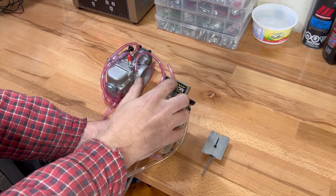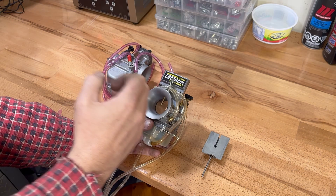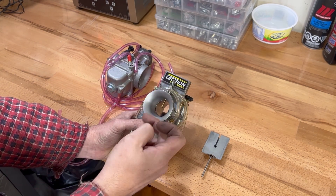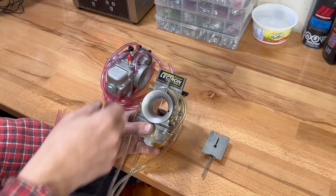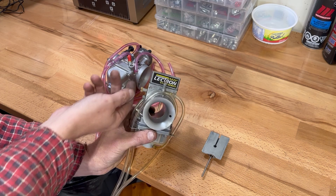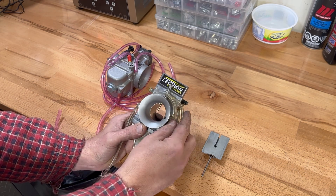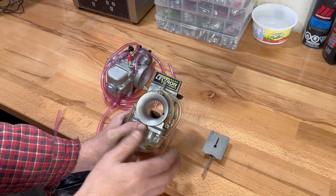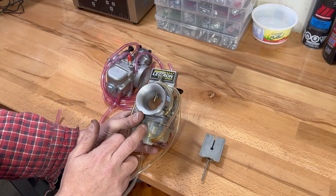When it comes to the power jet, it's actually opposite to what you'd think. If your bike's not revving out fully on full throttle — it's there but not pulling — that means you're too rich, too much fuel. So you screw it in to make it leaner, screw it out to richen it up. You'd have to ride the bike and adjust, but these are simple adjustments on the track. All the idle screw does is adjust your idle. Once we install this we'll get the bike running, and when the client rides it we'll fine-tune.